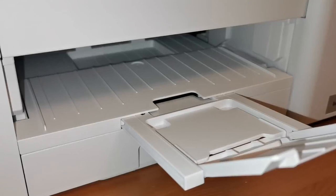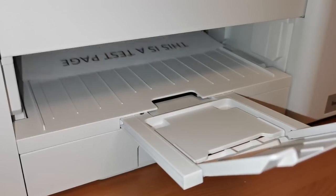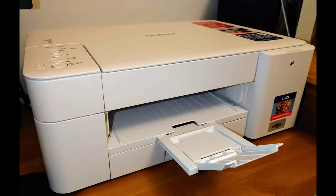I created a test page with a mix of different colours, black and white, text, and a photograph to test the print quality. In normal print mode it took around 16 seconds from pressing the print button on my PC to the printer finishing. In eco mode the same test page printed faster — just 12 seconds compared to 16. Eco mode prints are considerably fainter than normal mode though, so it's mainly for text use and ideal for saving ink when you just need to print something for informal personal use.